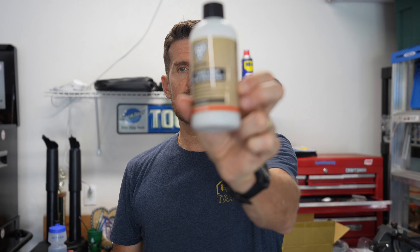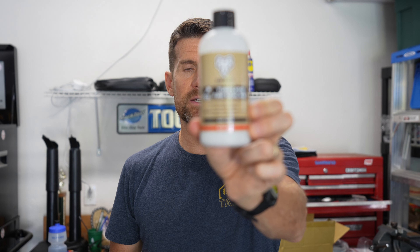A lot of modern mountain bikes today, especially mid to higher end ones, will come with tubes in the tires but they will include tire sealant such as this WTB sealant and also valve stems so that you can convert the tires to tubeless very easily. I recommend doing this because it not only gives the bike a better ride quality but it allows you to seal punctures in the tire while you're riding, so you don't have to repair the tire on the trail. Most of the time the sealant is going to be able to seal those punctures.